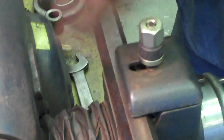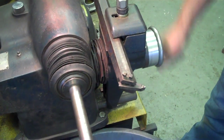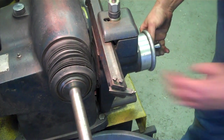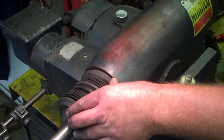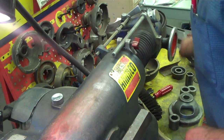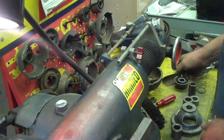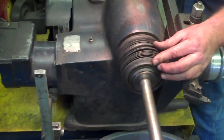So I put this on, put my cap on, and then I find the nut right here and just run it down loose. Make sure this is in neutral. For a drum, I go all the way in — till it's most of the way in — and then I back it off a couple turns. I go all the way back with this. I move this all the way in, back it out, and I move this arbor all the way in, which contracts this boot, and then I move it out about five turns. We're ready.